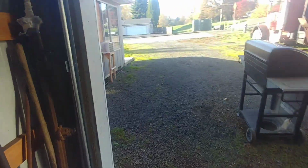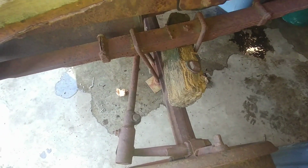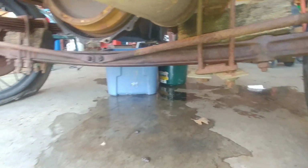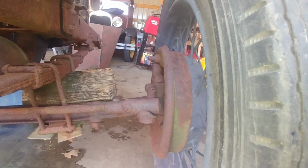He gave me a Model A front axle that has some stuff welded on it. I've got to cut it off and clean it up, but it's welded solid. The spindles are welded solid, and the benefit to that is a lot of guys, this was on a trailer, and one of the reasons it's on wooden blocks is these tie rod ends that are drilled and bolted to the axle to make it stationary. First off, those are only 5/16 bolts, which are probably fine, but if one of those shears, this thing's gonna go flying down the road, wobbling all over.